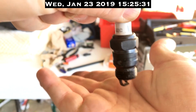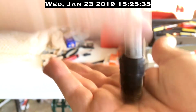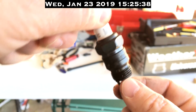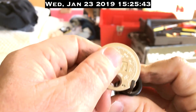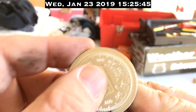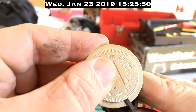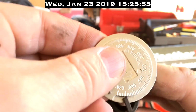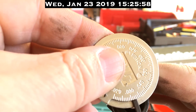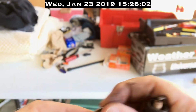For that, you turn it upside down about 5 or 6 inches above the concrete and drop it, and close the prong gradually until it is at 35 thousandths. So let's check where we're at. It looks like right now we're slightly less than. It starts to tighten up around 31, 32. Maybe you could stand to open it up a little further, but you see what I mean.